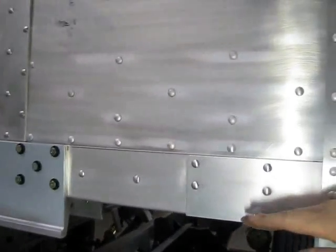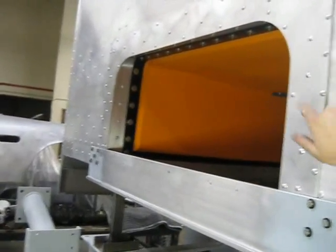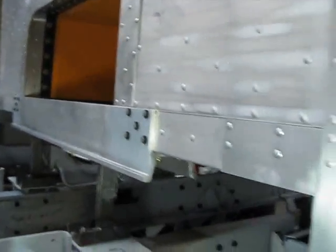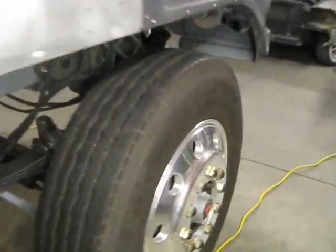The other structural improvement I made inside here was to add this quarter-inch — well, it's actually 3/16th — plate. It's angled to fit in the corner and then it goes right the way up to that floor section there. It's all one piece, so that entire piece goes from right the bottom of the floor all the way up, captured by all these rivets and the horseshoe reinforcement which they added later in '79. This didn't have it originally but boy it needed it. So definitely a huge improvement — any of you doing one of these, if it's early, you should think about putting that on, especially with a 108-inch cab. All the gaps are real nice and it's just taking a long old time, but that's what happens when you want to do things properly.